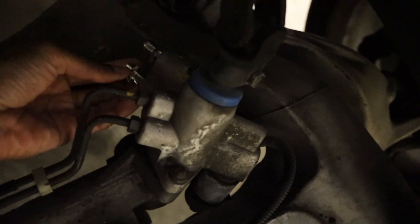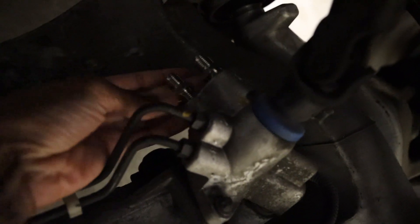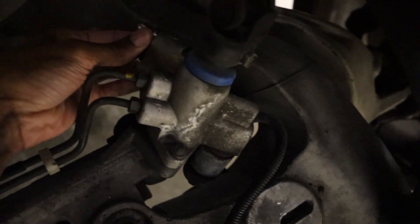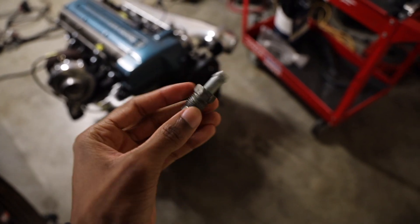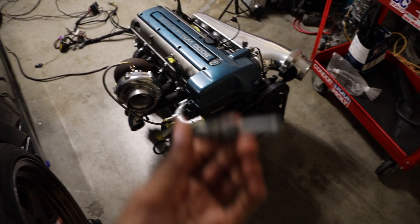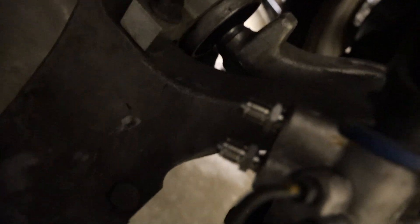When I grab one of these fittings — I'll grab the biggest one right here — it comes with a little gasket, just make sure you put your gasket on, and basically it just threads right in. Do the same to the other one, and this will allow me to run an AN line from here all the way up to my power steering and to the reservoir, which I still need to find. Once the engine is in for the final time, I can see what space I'm working with. Super clean, super sleek setup — shout out to GK Tech, not a sponsored video.